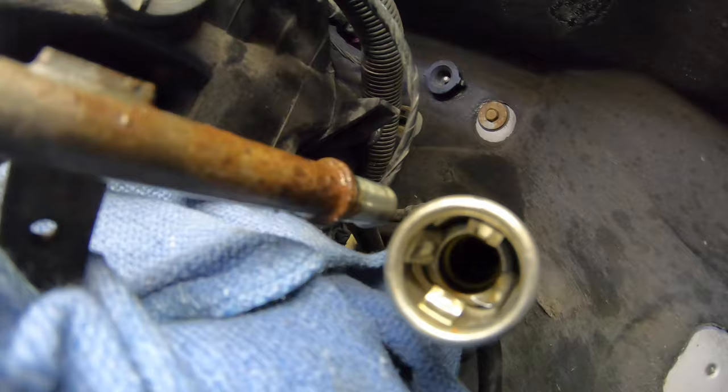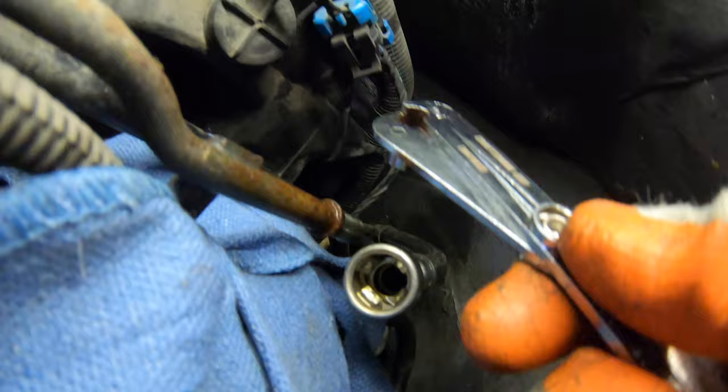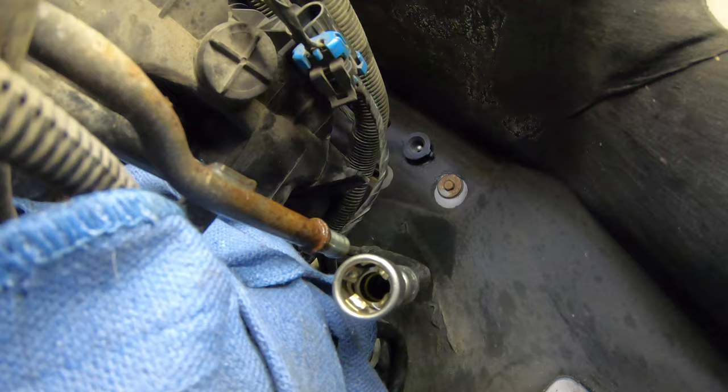There's barbs in there — four barbs — and this piece has got to push it down like that. The problem is that if it's right up against the lip — here's that lip right there — if it's right up against it, it won't push down, especially if it's an old car. This one has a little bit of rust on it. It's possible that on a new car it may not do that, but if you're having trouble, it's most likely because there's no gap in between the barbs and the lip.